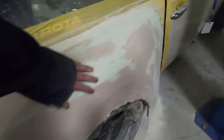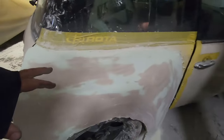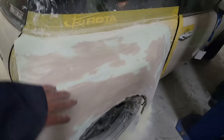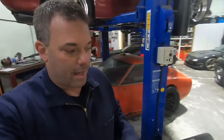In the five or ten minutes I've just spent using the DA sander, I've managed to do about four hours of work — great investment, I'll probably buy another one so I can have a couple going at the same time. I've smoothed off a lot of this top portion and got a lot of the imperfections out of it. Now I'm just going to go over this again with the DA, then mix up some more body filler, hopefully get a bit of shape in that guard, clean up these edges, and then start thinking about getting the wooden buck made so I can transpose this shape onto the other side.